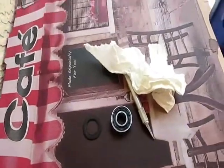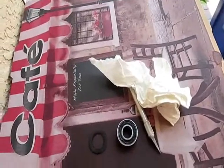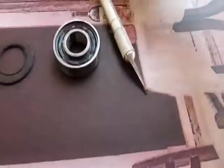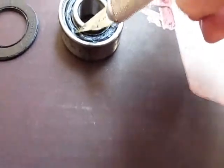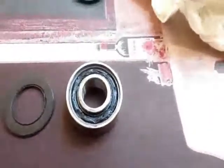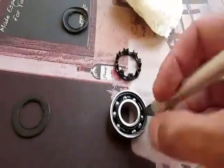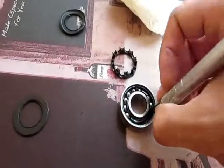Look at that — the plastic is coming apart. Junk. Then with these you can just pop that plastic cage out because it's a total wrap. Put your bearings all to one side and you can probably press that whole center piece and the bearing out.